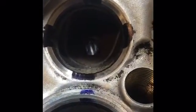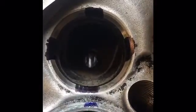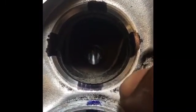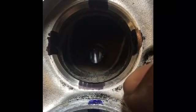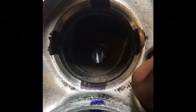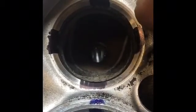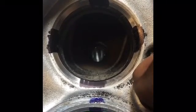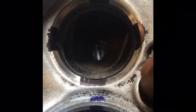Okay, I went back and I added in the black Sharpie. That way we can once again see the material we're cutting. And if you could see this lip, that straight edge right there, that skinnier one, not the one we just did, but the one just above it, that's the 30-degree angle that we are going to grind to smooth out. And this isn't as important as our 45-degree as far as it being smooth, but it being smooth does help get the airflow in a little faster.